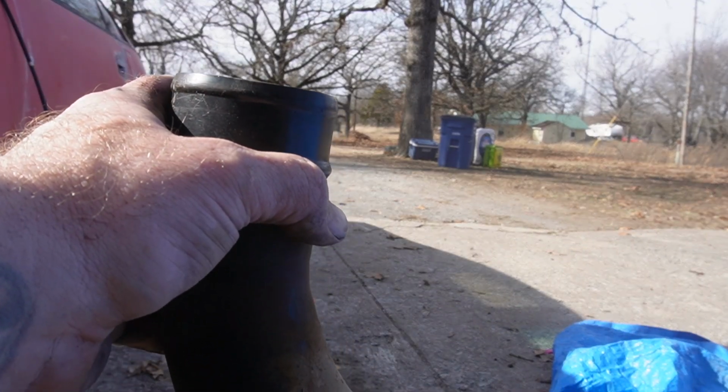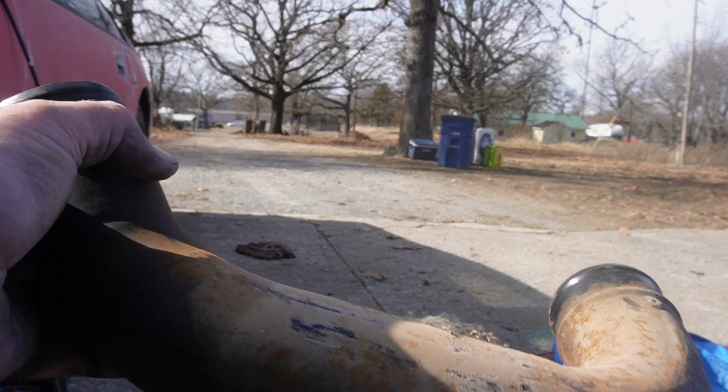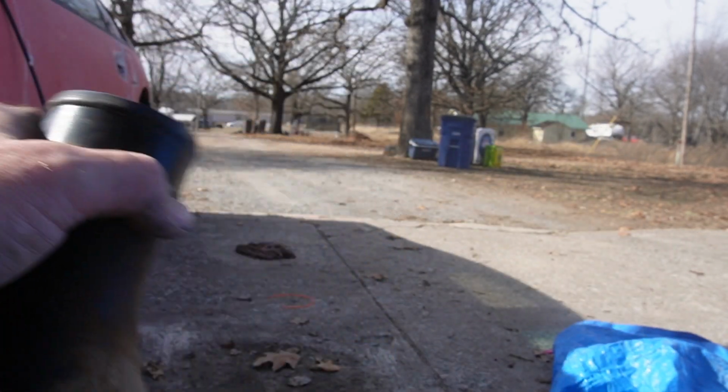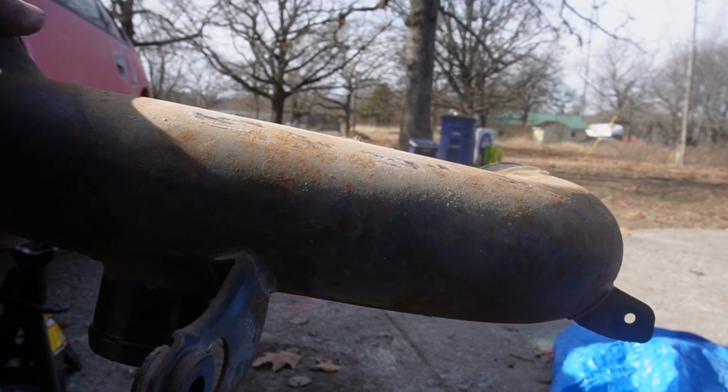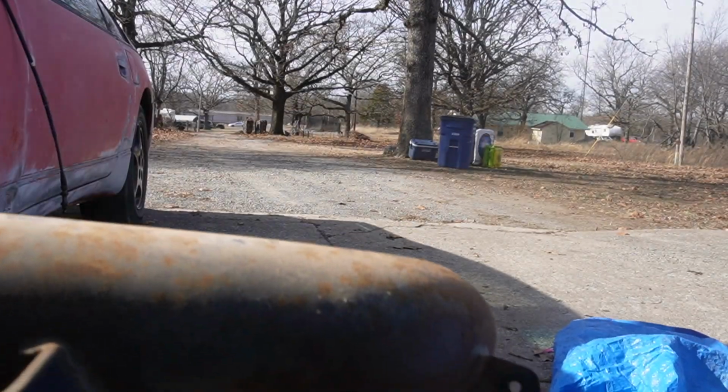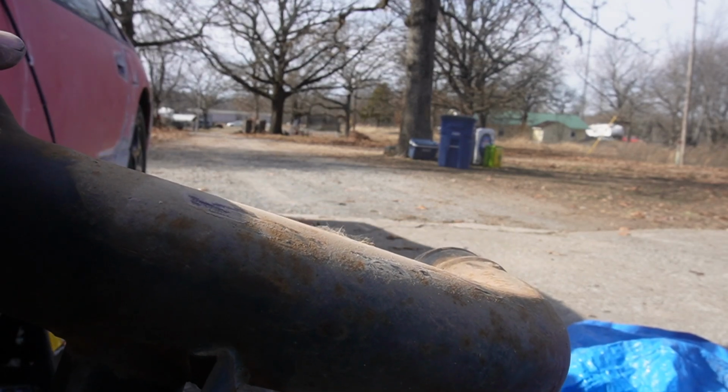So guys, in our delete, I got the intake tube out on the driver's side. Take out your air conditioner fan, cooling fan, and the air conditioner radiator. It'll make it a lot easier to get this thing out. You'll damage the radiator if you don't.